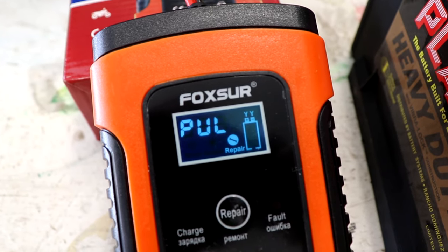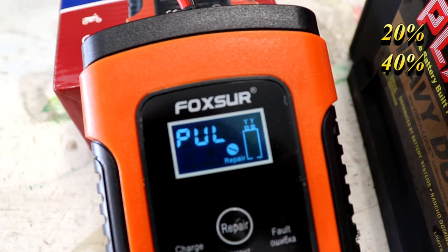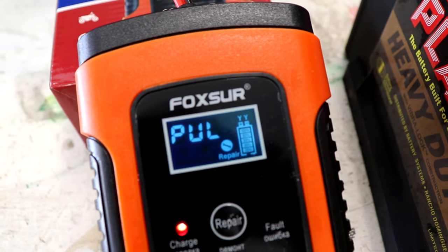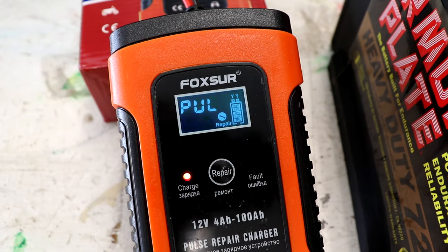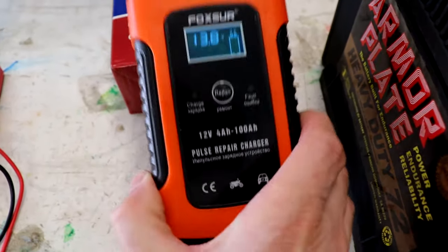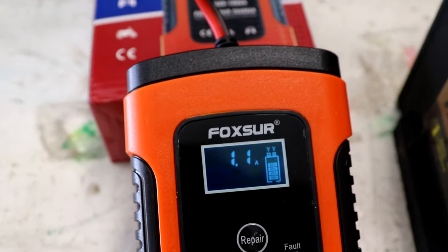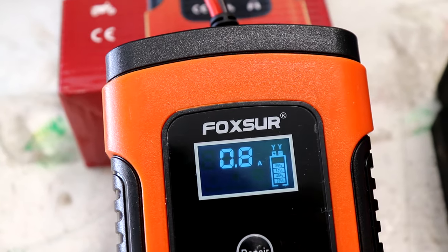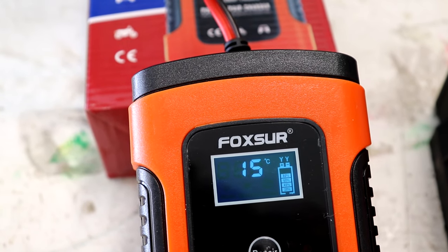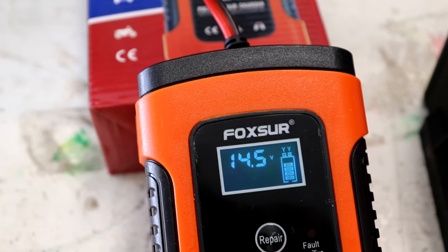Initially I was a little confused by the flashing battery indicator there, because all the levels are flashing — 20, 40, 60, 80, and 100%. I was thinking, does it think that it's fully charged? I don't think it does. I think as long as you have it on the repair mode, it's continuing to charge. If we take it off the repair mode, now it's just charging — the top of the battery there is flashing 100%, but it's still charging. It tells us it's at 0.8 amps, 15 degrees Celsius, and 14.5 volts. So I think we're in luck, we're still charging.